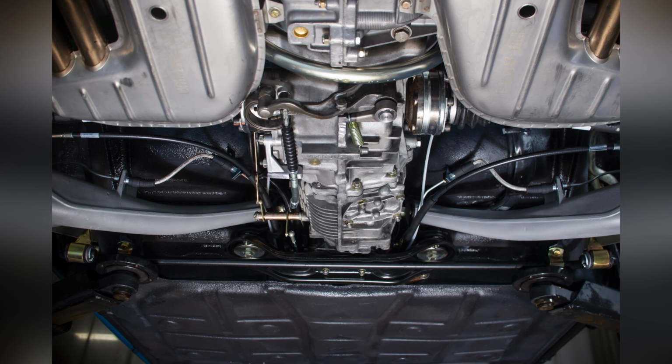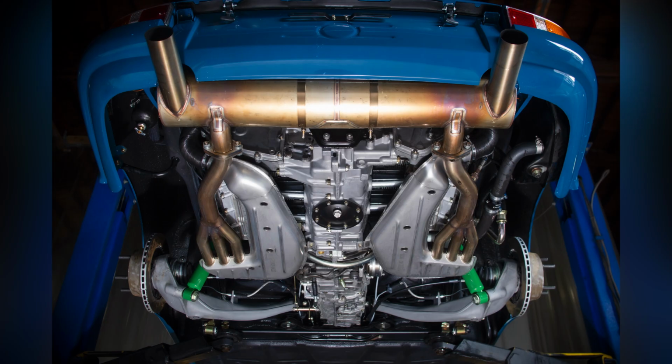The gearbox is completely restored, obviously rebuilt, and we always do a short second, third, and fourth gear. I keep first and fifth stock because you need your freeway gear going down the freeway. Always keep fifth and first stock, and it has a Guard limited slip, probably 80%. We'll verify that through Jeff. Of course, aluminum pressure plate, Sachs sport clutch, all that good stuff.